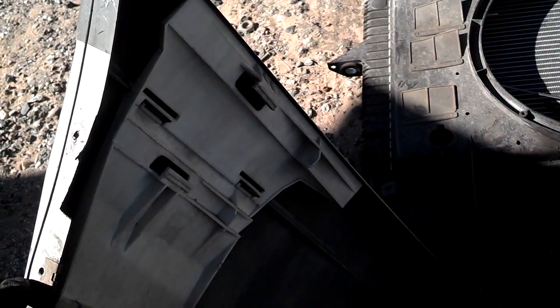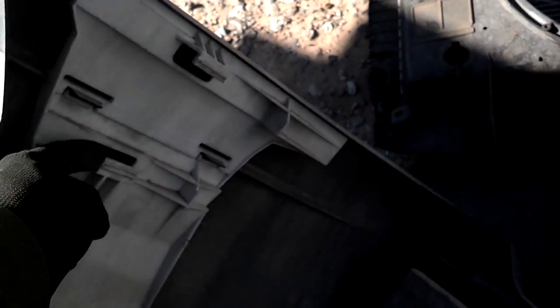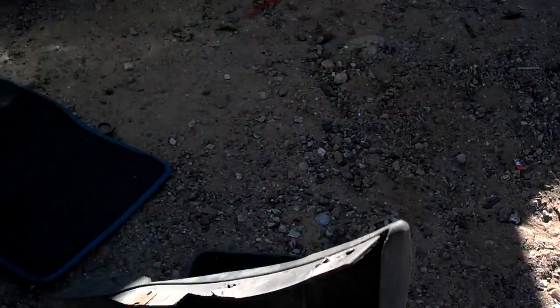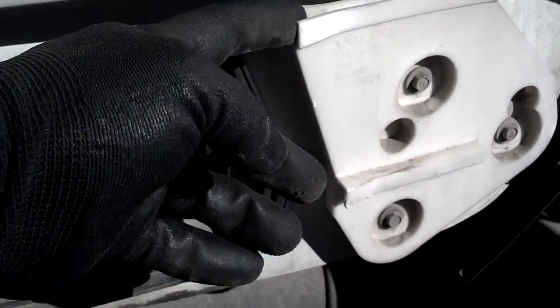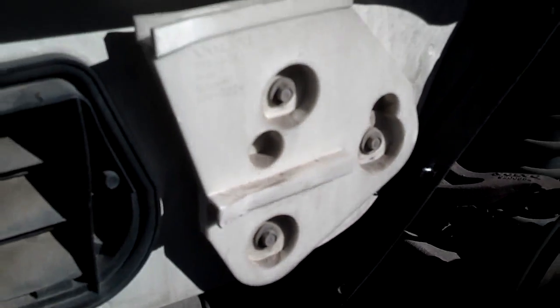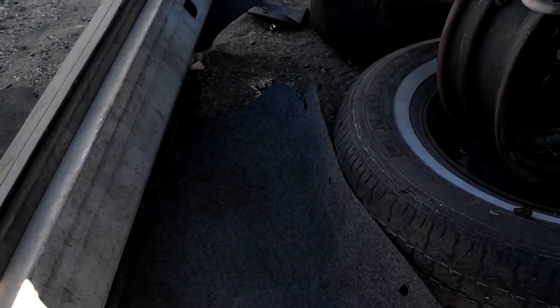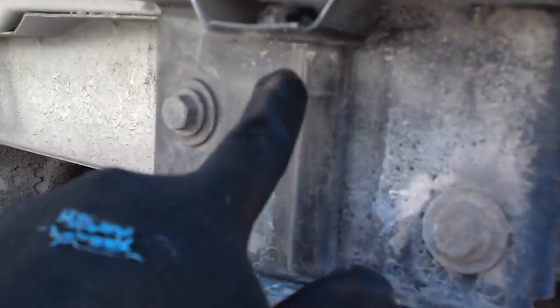When you're going back on with the bumper, the 850s have a screw in these two wings, but the V70s have these channels in the plastic. When you go to put this back on, you're going to have to make sure that that channel lines up with the bracket on the side of the car. The side of the car has a bracket that's kind of got a wide opening to hopefully catch those fins inside the bracket and guide it in — one on the top, one on the bottom. Make sure you get your sides lined up, push it on so that the aluminum part of the bumper fits in your bracket, and then your bolt will come up through the bottom of the bracket, go all the way through the bumper, and hit the nut that's part of the bracket.